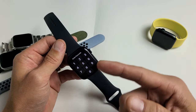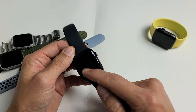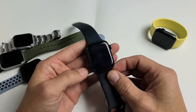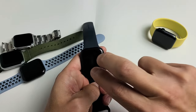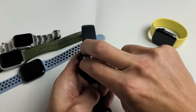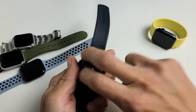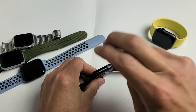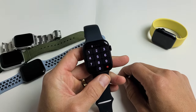If you're still stuck in a boot loop, the next step is what I call the tap method. It's possible that something is slightly dislodged inside your watch. Hold the watch and get two fingers and tap kind of hard all over on the screen. Sometimes even though you're stuck in a boot loop, all of a sudden it'll boot up the way it's supposed to. Then turn it over and tap everywhere — all on the back, all on the sides, kind of hard. Turn it back over and see if you are out of the boot loop.